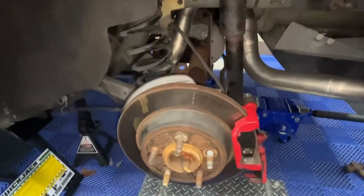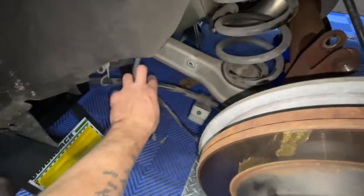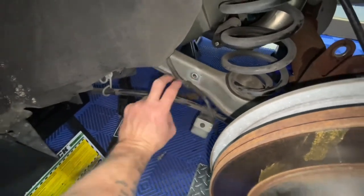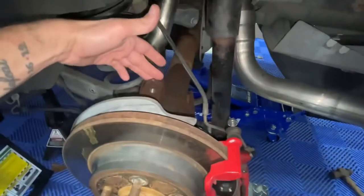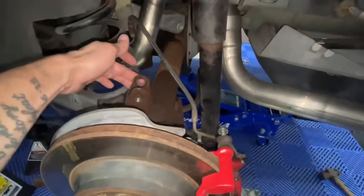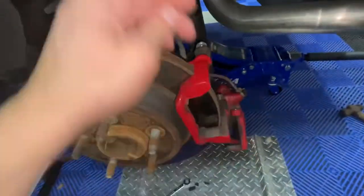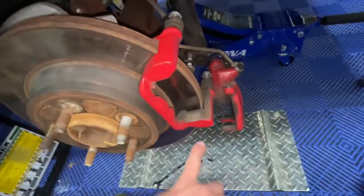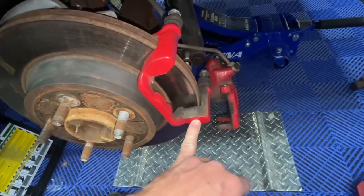We've made a little bit of progress. Took out the bolts for the sway bar — it's right here. The quad shock has been removed: 18 millimeter and 15 millimeter on this side, and 12 millimeter for the brake bracket.